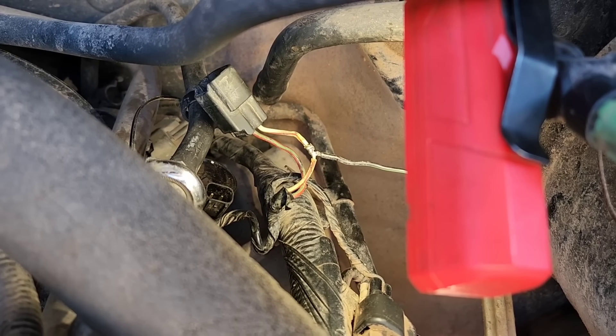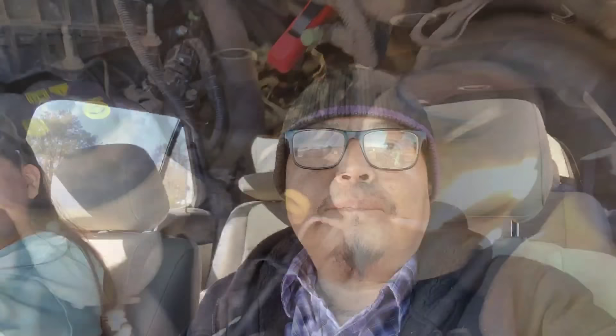This is shorting out and causing number eight to misfire. I looked through the whole thing and determined there are way too many wires in there to try to find the short, so I completely disconnected the remote starting system from that number eight coil. After I asked the owner, she said when she bought the vehicle she was never told about the remote start or given any key fob for it. So I just cut the wire and whatever is shorting out that number eight coil should now be disconnected. Hopefully it runs down the hill and back up.